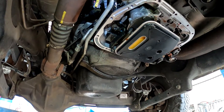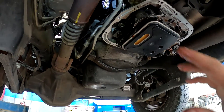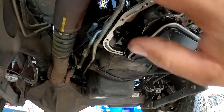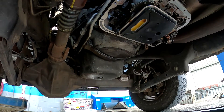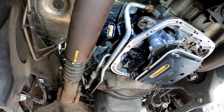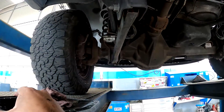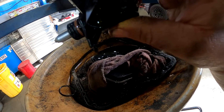In the case of this truck, there is an issue with lack of throttle input. It's a diesel, so there's no actual throttle valve — it's just asking for more fuel — but it does look at the transmission gear position and the speed sensors to allow the correct amount of fuel into the combustion chamber. I'm hoping I can clean this out enough to fix that. Engine oil pressure sensors and power steering pressure sensors can do this as well. I've had a case where a power steering pressure sensor allowed hydraulic fluid to go all the way up into the PCM, and the harness was effectively a goner. I'll do a couple more passes with contact cleaner and compressed air. You can see on the old switch just how much oil is inside that connector — there's a fair amount coming out, meaning this one is a goner.